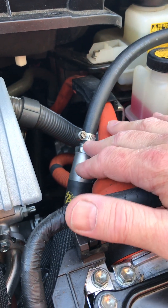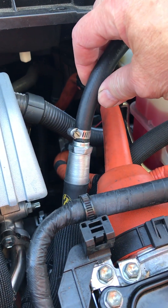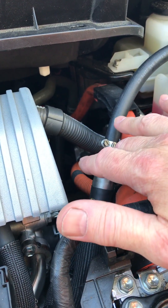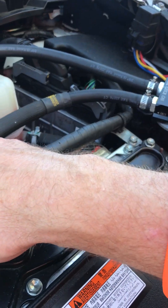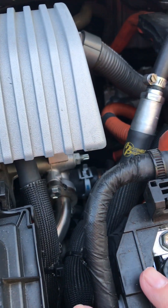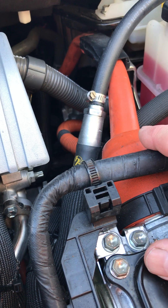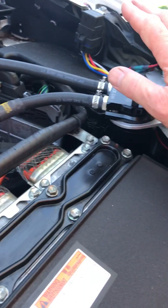It works wonderfully. I didn't get too high-tech on routing because I wanted it to be literally a three-minute PCV change — if this PCV goes bad it'll take maybe three minutes to swap. By moving it up in this position, the oil from blow-by has to travel up the line, past this valve, into the catch can, and back out. Now it has to make a higher journey, so oil will likely go partway up and drip back down into the crankcase.